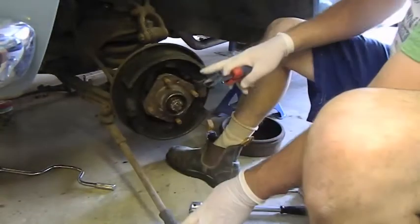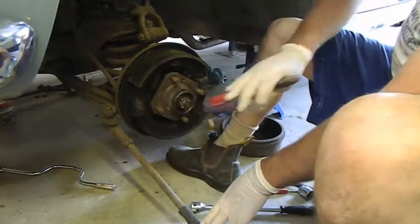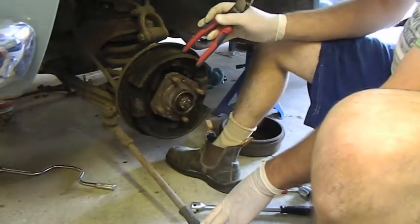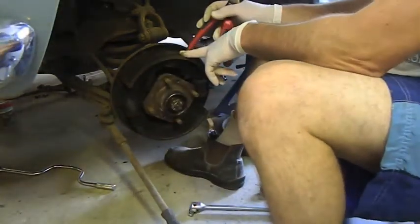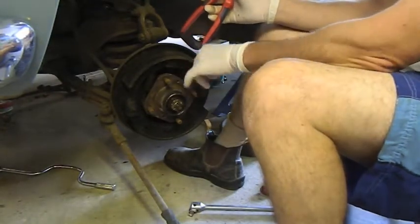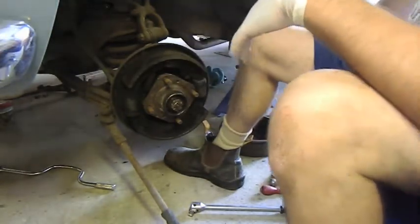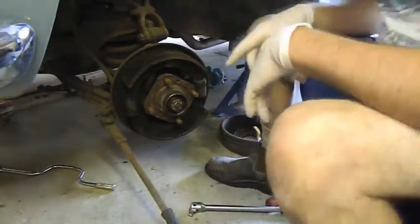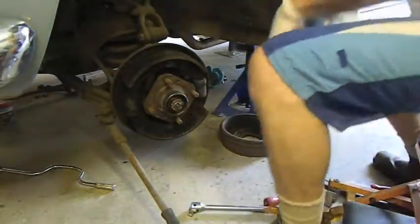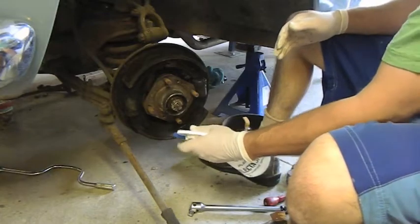It's really good. Now, brakes. These things, I'm going to take these linings off, put new cylinders on, and send these away to be redone. I'm sending these away with the drums so they can be radius ground and all this sort of stuff. Now, given that this is quite old, it doesn't look like the brake linings are all that old, but I do want to protect myself from it because there could be asbestos in there. The best way to do that is just to spray everything with water to minimise the chance of dust.